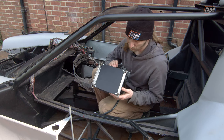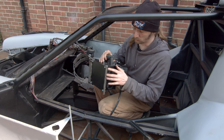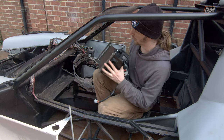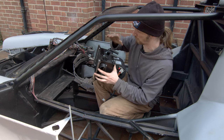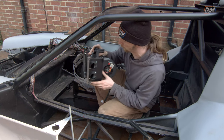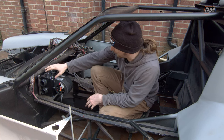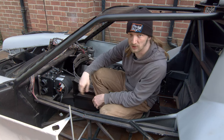Mounting is nice and simple — we've made a couple of little metal brackets that just sit behind the screw holes, one on each corner. We're going to weld the brackets to the car and then screw the box onto the brackets. We've got it all screwed together to align everything, pop it in place, see where they line up, sand all the paint off, tack them in, and we should be good.